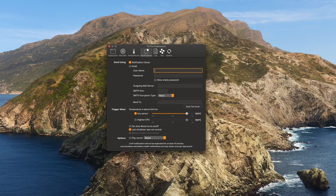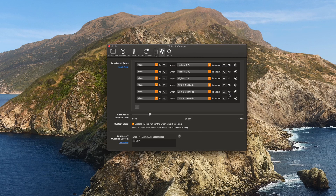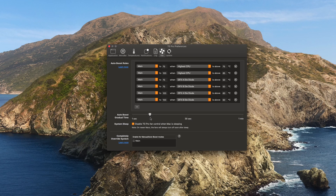The CPU, GPUs, and SSD are all going to be getting hot at the same time. The acceleration of that heat meant that by the time the fan spun up, it was just too late. That sounds like a pretty horrific flaw, but it's actually very easily resolved with a third-party app. I use TG Pro — it doesn't cost very much, and it gives you the ability to manually ramp the fan up, or you can program it. I've got mine programmed to ramp up to maximum speed by the time any part of the system hits 60 degrees centigrade. Ever since I did that, I've never seen temperatures above 62 degrees, and I've not had any overheating issues. The Mac Pro design is clearly capable of cooling all those components — you just need to tweak the fan curves. The great thing about having an app to control the fan is that you can switch it on and off manually, so if you need silent running for audio production you can do that, and if you need maximum cooling whilst rendering, you can do that too.